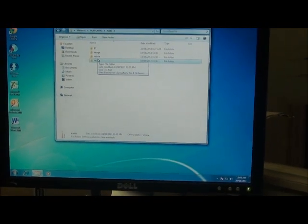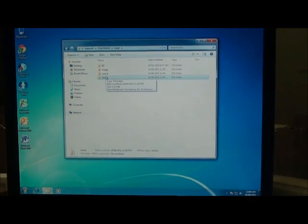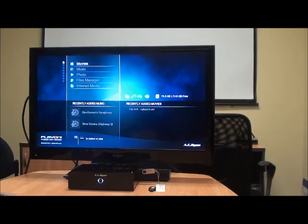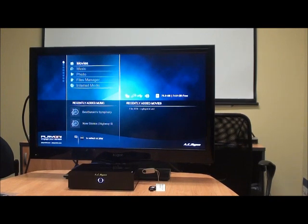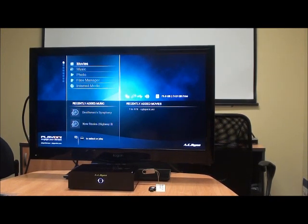So we'll do the cutscene. The last stage will be the firmware upgrade. Okay, and we're back. Now the last stage of the review here is the firmware upgrade. What you want to do is go to the AC Ryan website, or you can just go to playonhd.com, which will get you there as well. Now go to support, then select the model of your device — ours is the PlayOn HD 2. It'll show you a list of firmware upgrades — obviously download the latest one. The download will come as a zip file. Open the zip file and then copy the install.img image file out of the zip file onto a USB stick.